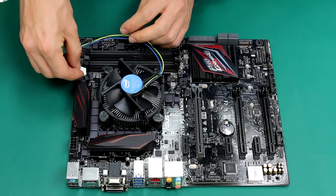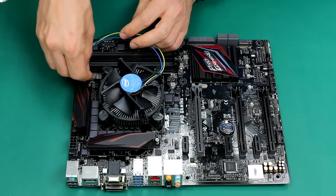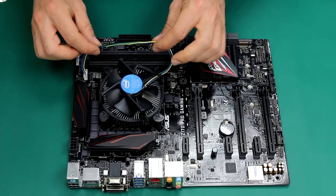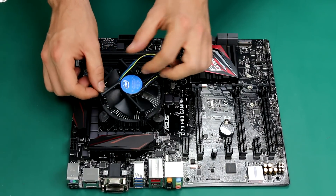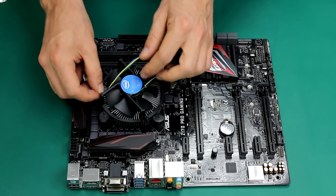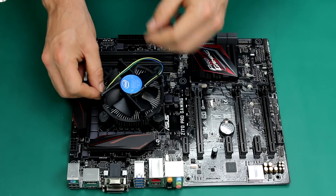So you want to do this — it's very, very simple. Be gentle, it's going to go in smoothly. One thing you want to take care of is this cable. You do not want this cable to go in the middle here, otherwise it's going to be clicking or, in a worst case scenario, you could block the fan causing your computer to overheat.